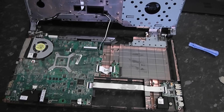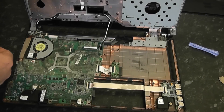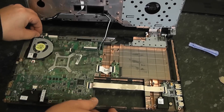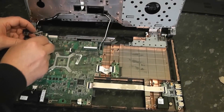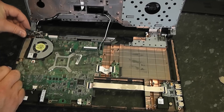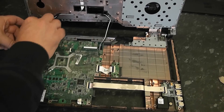This is the actual DC jack here. It's got what we call a pigtail because of the cable on the back. So we're just going to put the new one in now — just clip this one in. You can use a spudger to push the connector in if you wish. Slip that into position and then just screw it down.